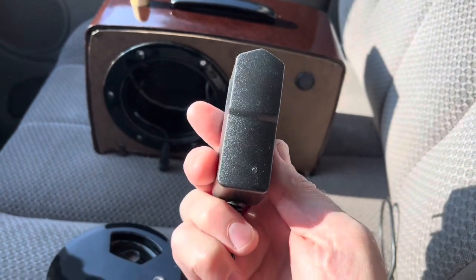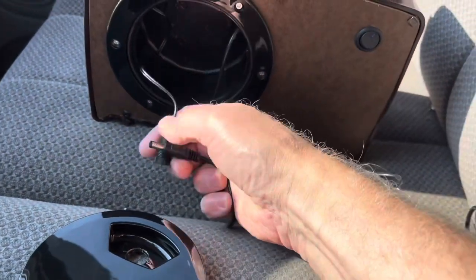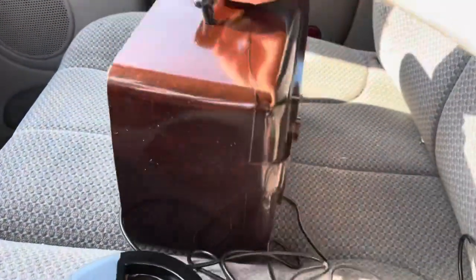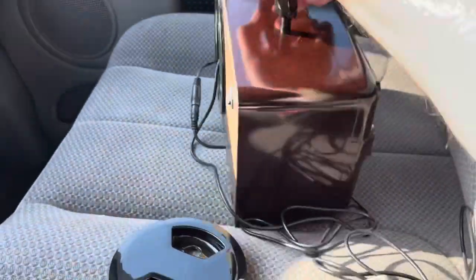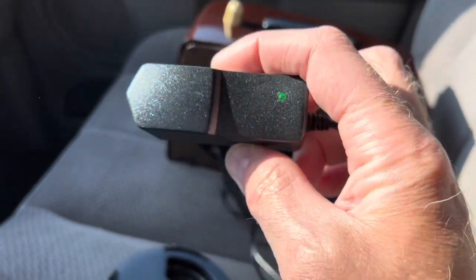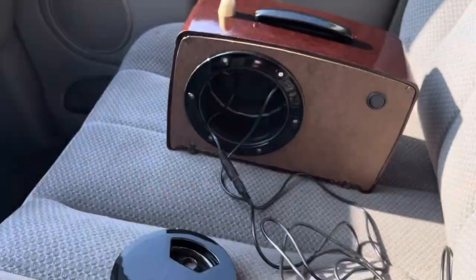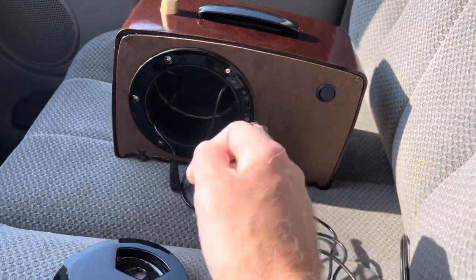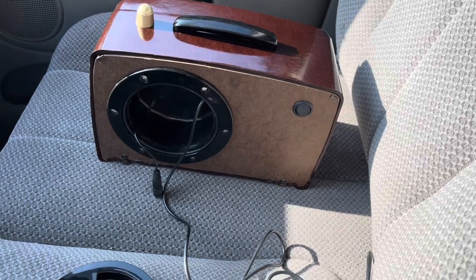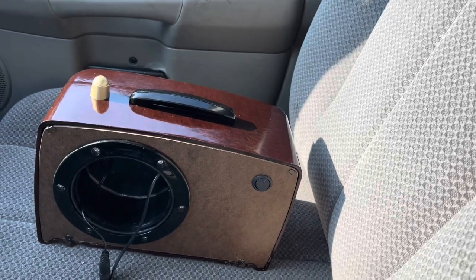This is the charger that comes with the device. Go ahead and plug that into the charge port. Make sure the device is off while charging. You'll see it light up green, then plug this into the wall. It'll turn red and stay red until it's fully charged, then it'll turn green again. Once charged you can disconnect it. You could leave it plugged in overnight, just don't leave it plugged in longer than that — it could make the battery wear down faster.